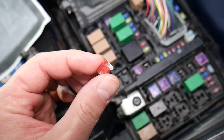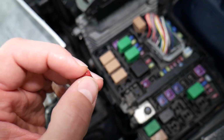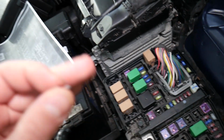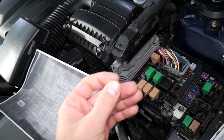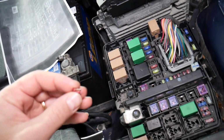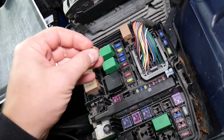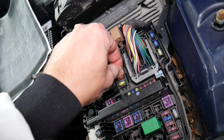Also, guys, even if you're replacing them with a new fuse, always test them as well, because sometimes you may have a defective fuse. Your Kia Optima, let's say, doesn't start, and at that point you're putting in time and money that you don't have to. So we recommend, guys, to always test these fuses before putting them in your vehicle, so you can eliminate a problem like that.